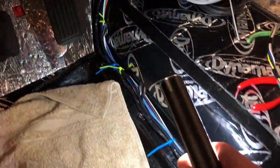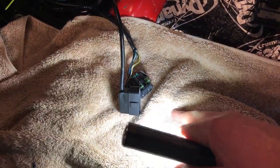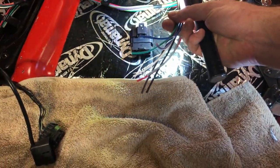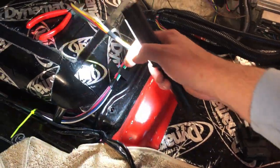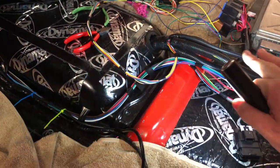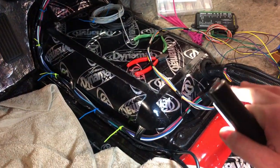I've got the OBD2 and the TAC module — the TAC module is going to sit here, OBD2 is going to sit on this little rib right here to keep it up, and then the rest of the wires go this way and come down here. I haven't terminated them yet — I'm actually going to put this connector on right now so that I can interface with this bundle of wires coming off the ECM. I just wanted to put a connector there so that everything is disconnectable. I don't like running hard wires from point A to point B with no way of disconnecting them.